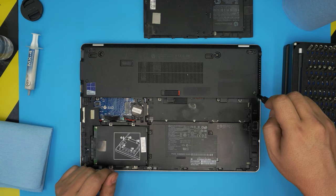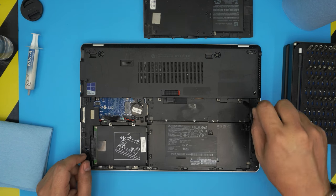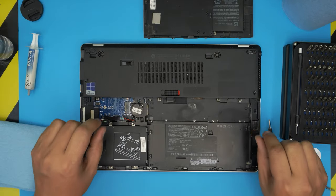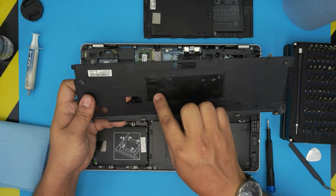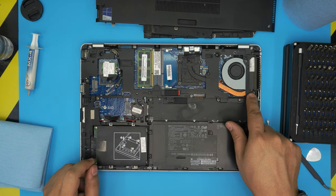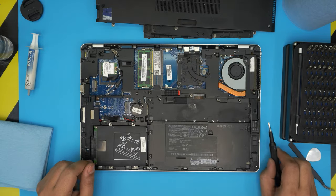Next, remove the cover on the top side by loosening the screw on top of the case — it's a long screw with a C-lock and won't come out. There are three screws total: one on top, one on the left, and one at the far end. Flip the cover like a book pamphlet all the way towards the back. Clean up the dust mesh. You'll see the fan and heat sink, which is placed under a metal bracket.